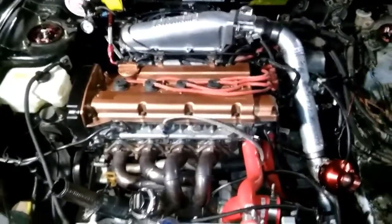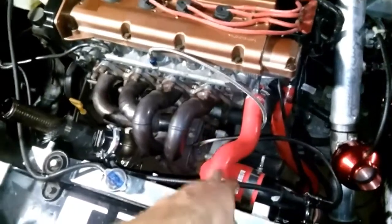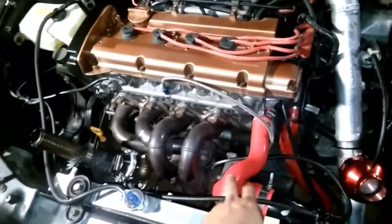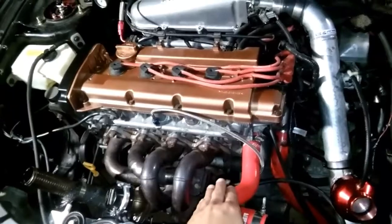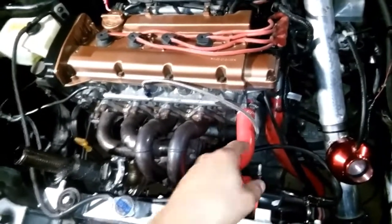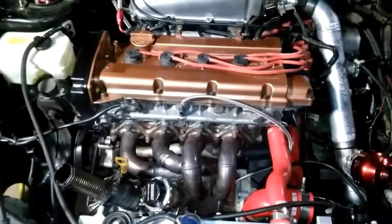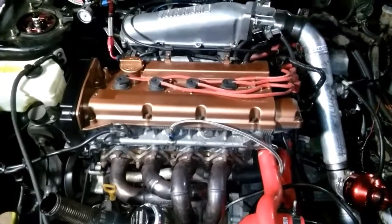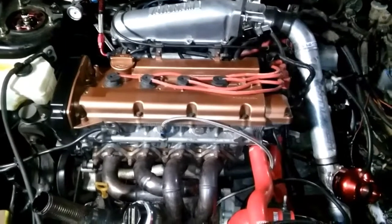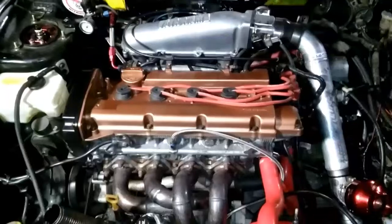That's what we made. We did that on a completely stock 18-year-old bottom end. It's got 123,000 miles on it. It came from Hyundai. That's the original motor to this car. And then we have a semi-built head, which only has stock cams in it, which is a limitation to the RPM, which is 7,300 right now.